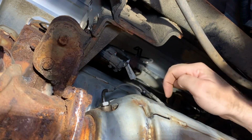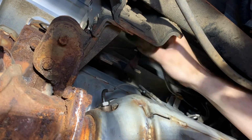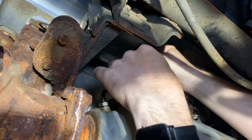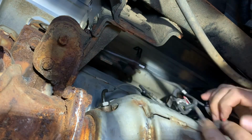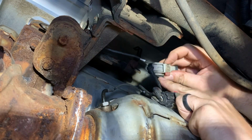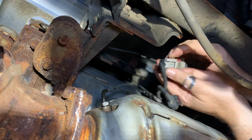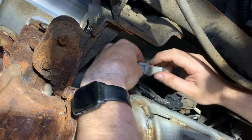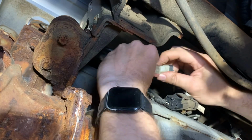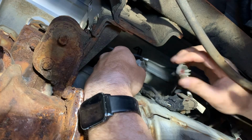While I'm down here, up above the EGT sensors are the plugs for the two SCR sensors, so I'll measure them in the same way. Pushing the red clip to the side will allow me to disconnect and access the pins for measuring resistance. Also, you'll need to reference the chart in the PDF manual to match the resistance to your ambient temperature when taking these measurements. And you may need to work the red tab back and forth a few times to get the plug out.